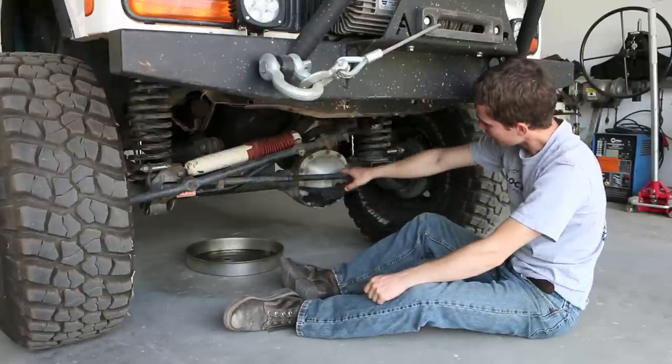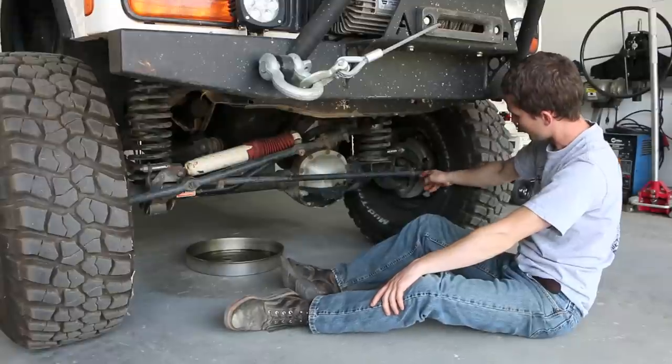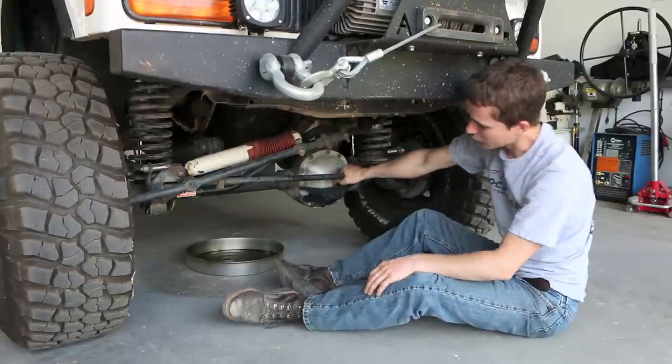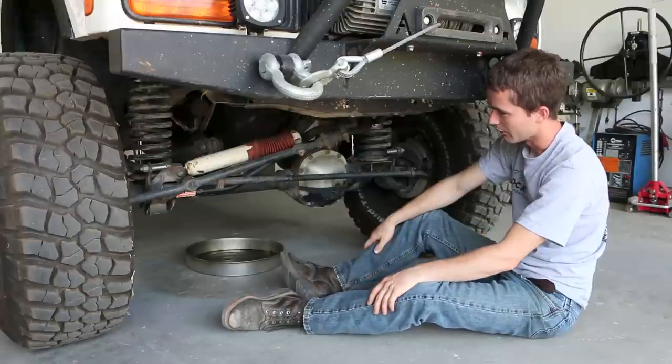The factory steering we have here is all going to be replaced with that kit. The rod ends are extremely flimsy. This tie rod is almost the same size as my index finger. It's just not quite suitable for taking abuse off-road, but the kit from Rough Stuff will certainly take care of that.